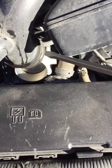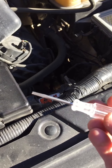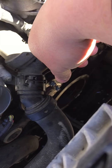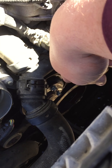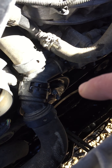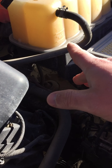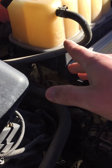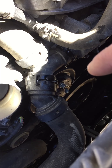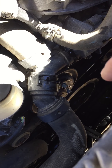Mine was leaking right here, so I replaced the O-ring in there — that's hopefully all I'm going to have to do. You've got to take your airbox off, part of it. Some guys will take it off right there; I just took it off right here. There is a little sensor that goes in right there. All you'll need is a big flathead screwdriver to undo that, and a little screwdriver to get the O-ring out. These things have clips on them.